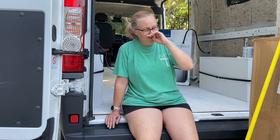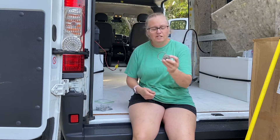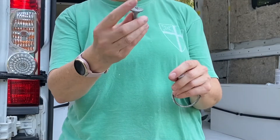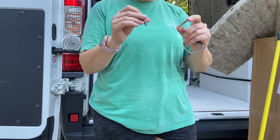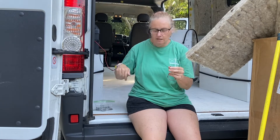I'm cleaning up because I like to have a clean workspace, but also because on my forums somebody chimed in when I was asking about the best bolts to use to go into my plus nuts. They mentioned that stainless steel is not good when it's in contact with galvanized metal that could get wet. When I took out the bolts used for the tie-downs, the heads were kind of rounded and the bolts were pretty short, so I replaced them with longer flat-head stainless steel screws. But I was informed that stainless doesn't play nice with galvanized metal - what can happen is if it gets wet, the metal under the van would rust rather than the stainless steel.